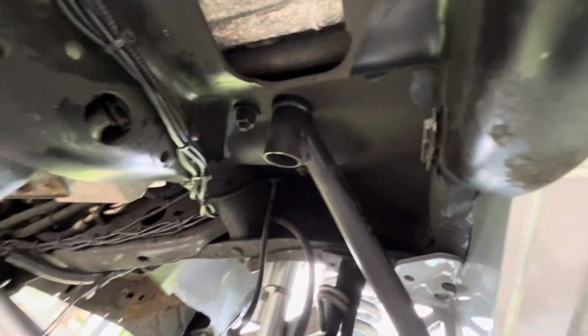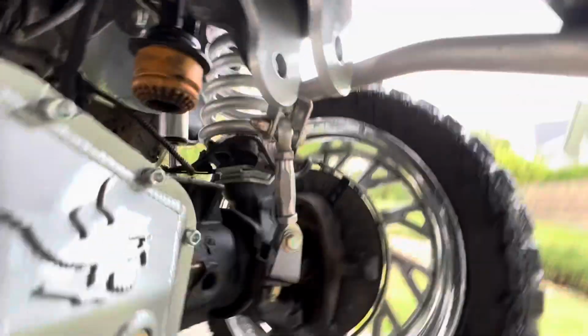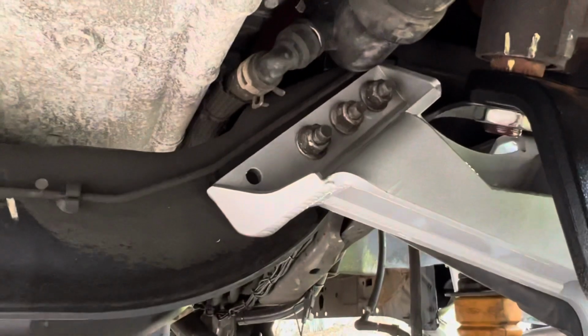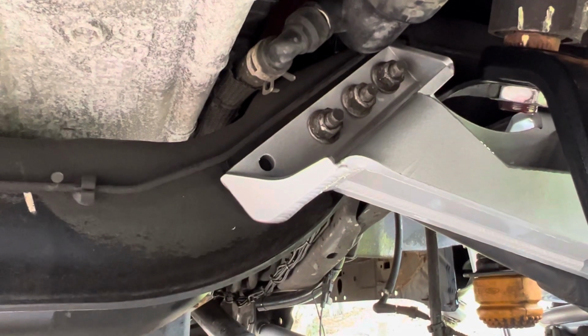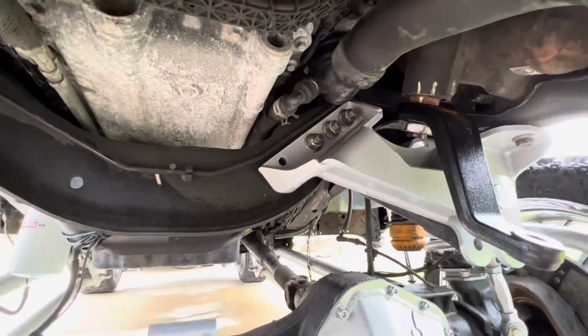And then this is the tubular support or whatever that came with my Fab Tech that I told you I'm taking off. So it's 24 millimeter for the engine mount. So I'm going to take that off, tighten it back up, because obviously you see it doesn't line up. If you can tell by the holes, she don't line up, and we don't need it. So once we get everything set, we got that hole right there. We're going to drill another hole, and we're going to Loctite, put a grade 8 bolt in there, and tighten her down. And we will continue.